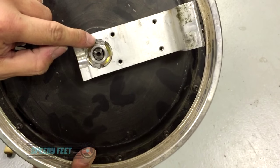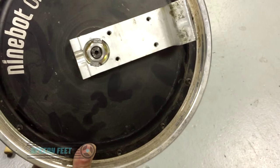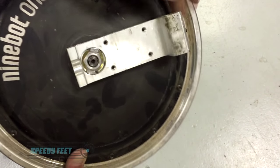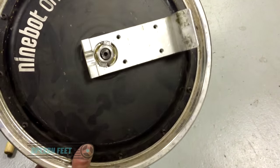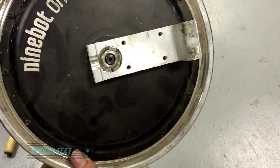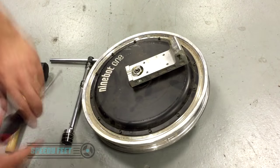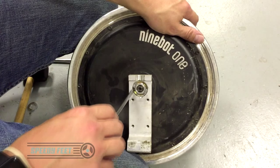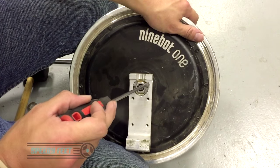As you can see here you've got a lead lug there and there. What that does is it holds this nut in place to make sure it's not going to come undone whilst you're riding. If you left them out and left this loose, you'd find your right footplate — or left depending which side — would wobble left to right and you'd know straight away something was up. It's not inherently dangerous unless you kept riding and ignoring all the warning signs. So that's what this is here for — safety, basically. Those need to be removed using the flat screwdriver.